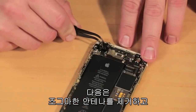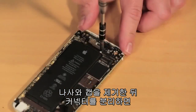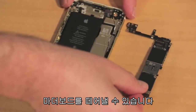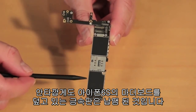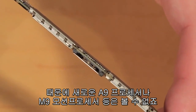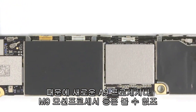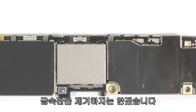A small antenna comes out next, and then after removing a few screws, dealing with a new hex head standoff, and attaching the remaining connectors, we can lift out the motherboard. Unfortunately, the shields that cover the iPhone 6S's motherboard are soldered in place, obscuring our view of the new A9 processor and M9 motion coprocessor that's built in, and most of the other chips. As I want to put this phone back together in working order, I'm going to leave the shields in place.